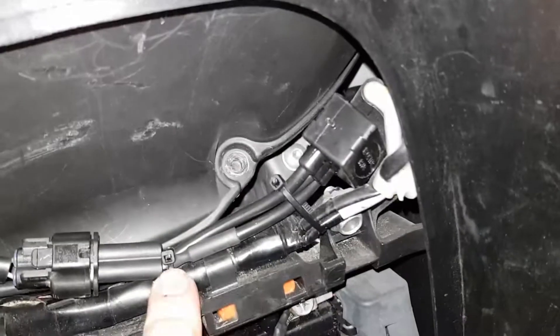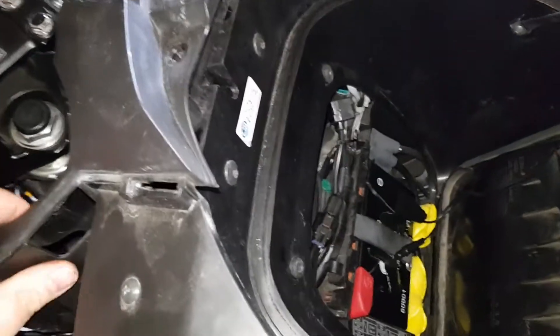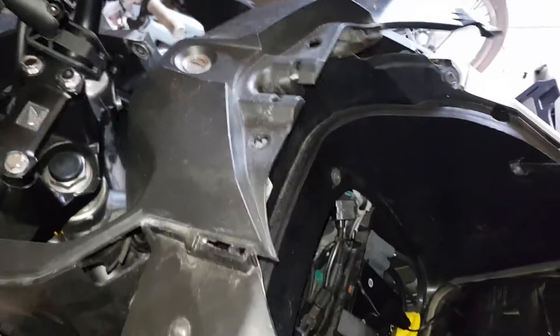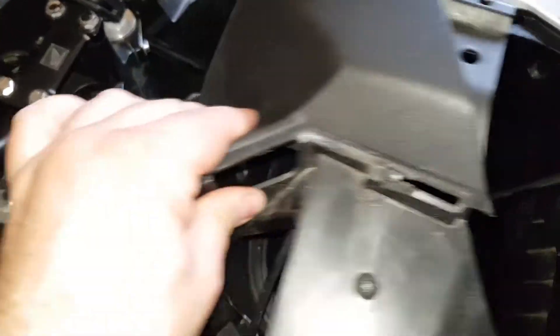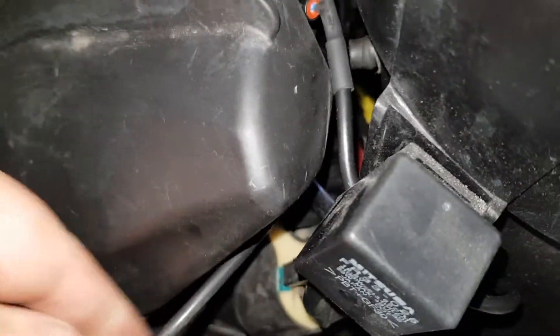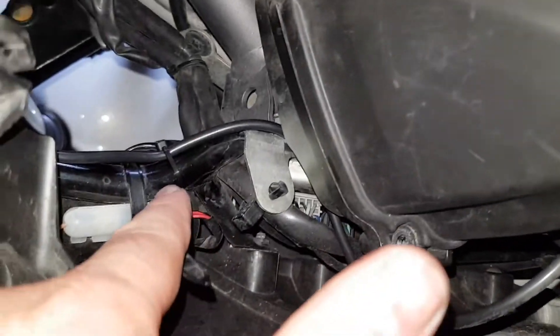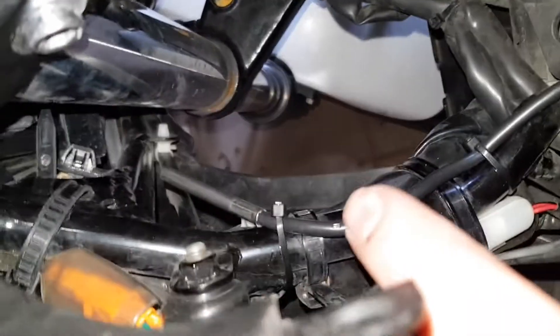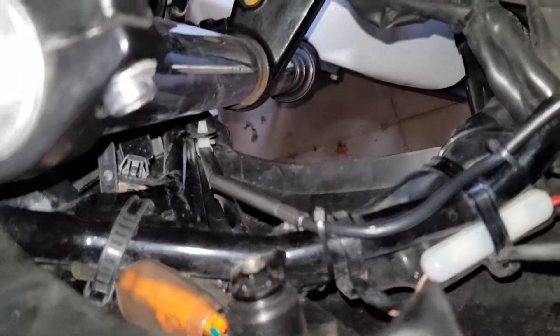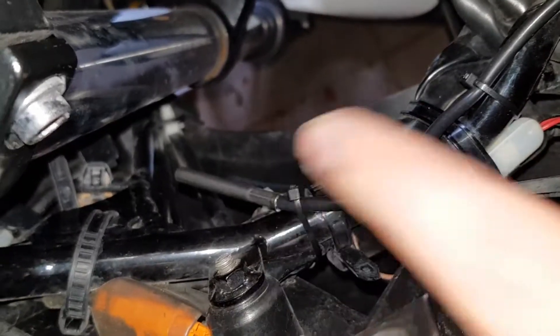I have just zip tied everything. The booster plug comes with quite a long lead going to the air temperature sensor for the booster plug. You can see that cable coming out here — I have routed it and zip tied it, and then out here in the front left, behind the fairing, this is the air temperature sensor — that's the shiny thing you can see there.